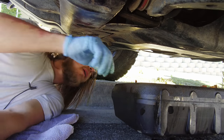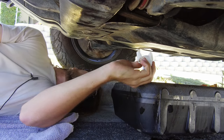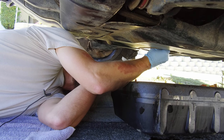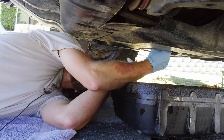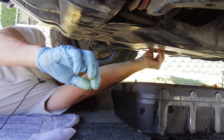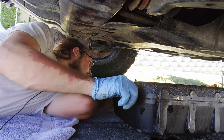We're back underneath. Get your paper towel ready, wipe up anywhere that might still drip. I'm getting ready to put the drain plug back in, so I'm gonna give it a quick wipe where it's dripping, put the plug back in — finger tight is all you need to really keep it from dripping too much more. Give it a good wipe down; no extra oil, want to keep things clean. Now we can push our oil pan out of the way.